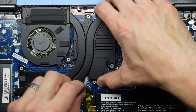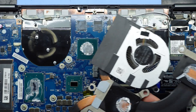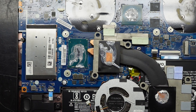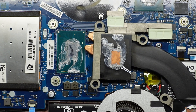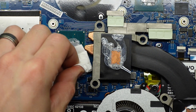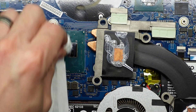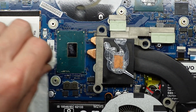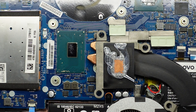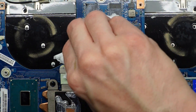And we're lucky — it will want to leave. As you can see it has had thermal paste replaced on there before, and that one looks very unhealthy — it's gone everywhere. So that has been replaced at some stage. I'm going to use some isopropyl and a tissue. It's very much overboard — I like a sufficient amount of thermal paste but something like that is just way too much.